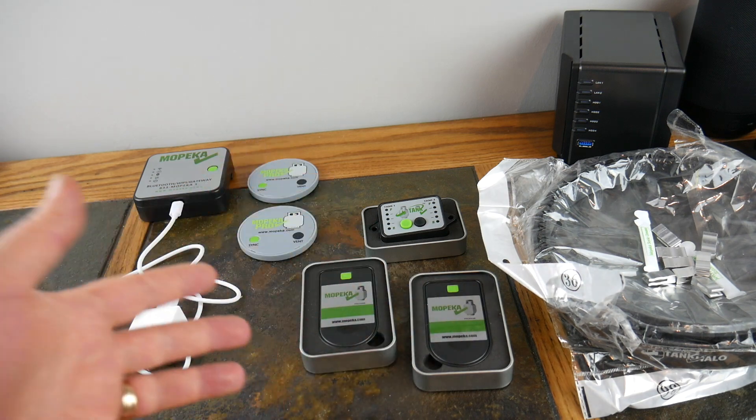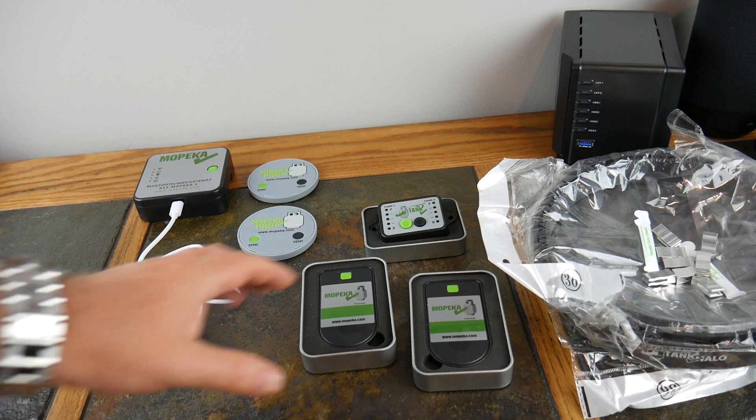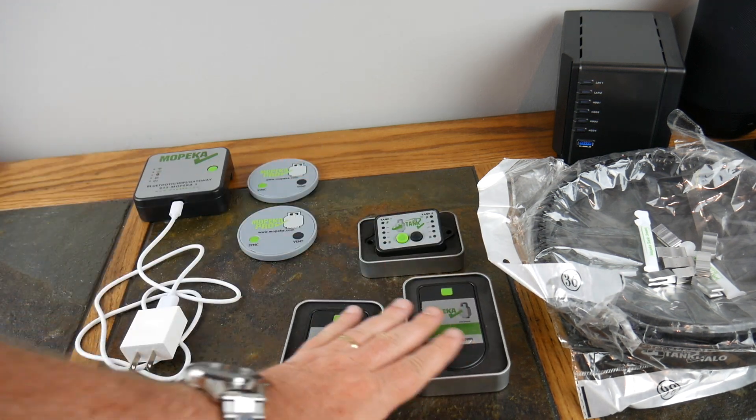You have a visual monitor inside your RV that you can just look at and say, oh, I don't have to get out — I'm out of gas. Hopefully it's not your sensor malfunctioning, but normally you're going to have some kind of problem: your heat won't work, your refrigerator's going to die, your stove's not going to work, your hot water heater may not work. And you're like, oh, I might be out of gas. Here's the middle solution, and again this will work with your app.